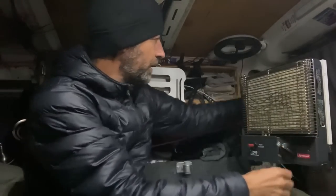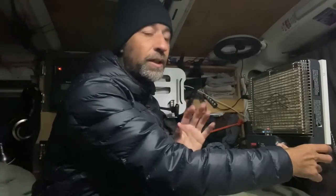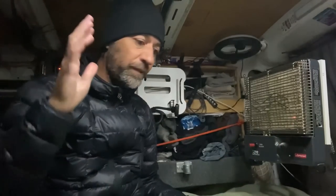Now that it's cooling down in here, I want to get the heater back on. I do want to make one other point: I lose a little bit of heat out of my van because I always keep my vents open. I've got my roof vent and my floor vent that stay open all the time — I never close those down, especially if I've got a heater running. I want the oxygen to be able to flow through here, which is why I've got both a floor vent and roof vent so that fresh air is always flowing through the van. On really cold days, I'll just close my roof vent down to about an inch or less — that way I still have fresh air flowing through but I'm not letting all the heat escape out the roof.